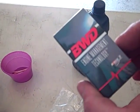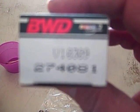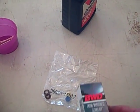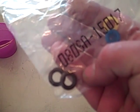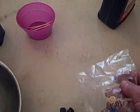I purchased from Pep Boys a Borg Warner rebuild kit. The part number is 274081, and it was four bucks — so I bought four of them and invested another $16 into my bucket. This is the kit and the contents. It's got two O-rings, one for the top and one for the bottom at the injector port on the fuel rail. It has a plastic spacing washer or bushing, and it has a new hat for the injector tip cover.